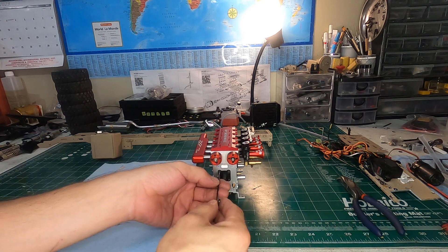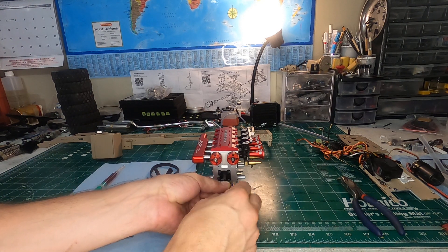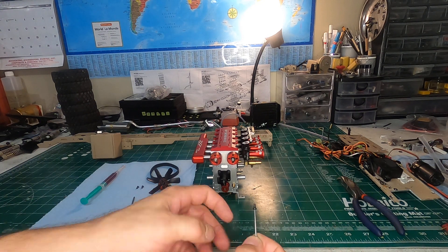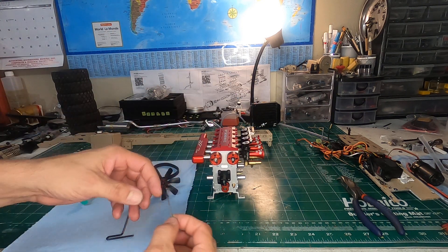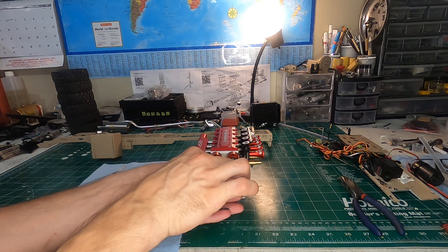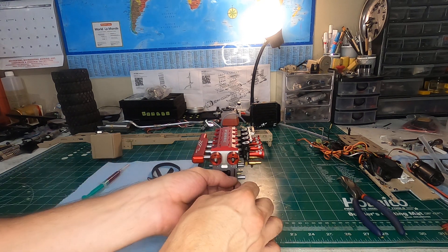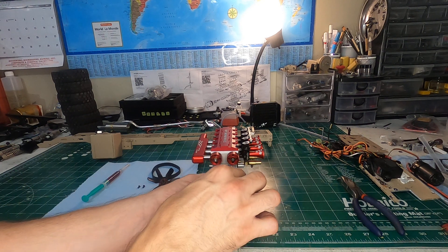When you're loosening things off, try to loosen bolts off in sequence so that you don't warp anything. What I've done here on my engine is I've added a button head cap screw to the side where the belt is on this corner, because the belt comes down here and on these cap screws they actually rub on the belt and I don't like that personally. So I used the button head cap screw in place of these little ones — the manual will have the original size and all I did was get the same size in a button head form.